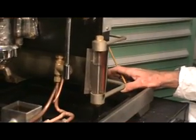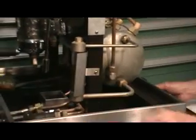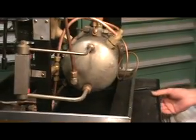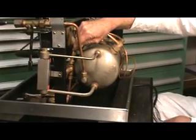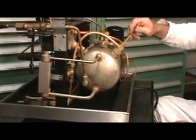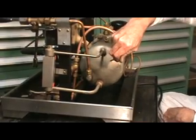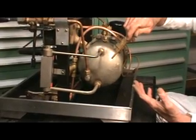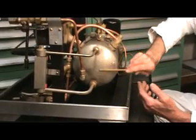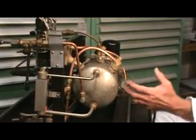The footprint of this machine is quite large, but the case is even larger. You can see the way the sight glass is hooked with a little reflector — there's a fascia that fits over the front. You notice as we come around, these are the lines for the heat exchanger. This comes from the cold water line and the pressure control. The heat exchanger is about two inches in diameter, and it's mounted about here in the boiler. When you have the water set at level, most of the heat exchanger is in the steam, and only the very bottom of it is in the water. As the water level goes down, the heat exchanger is completely in the steam — it's about in this position.